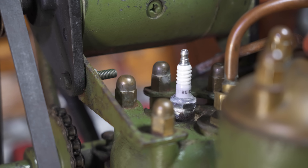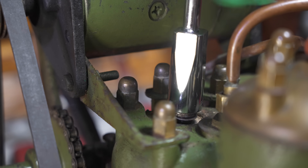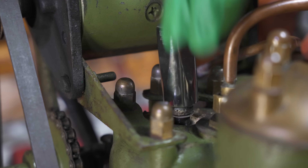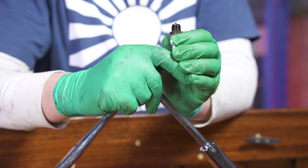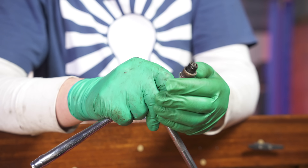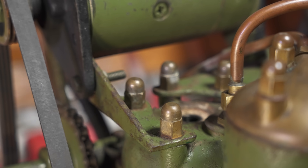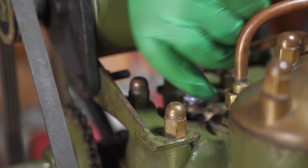So the next thing is the spark plug — let's just pop off the lead and do this to see what's been going on. You can see whether it's too oily, too sooty, or just right. It is quite oily, but actually that's only the threads, which is good. The rest of it is looking quite dry. We're sort of looking for this kind of slightly wheaty sort of colour — there's no soot or anything. So it looks like it's not pretty on the outside but it's certainly looking good where it counts, where the electrodes are. So that can pop back in there — we're good to go with that.